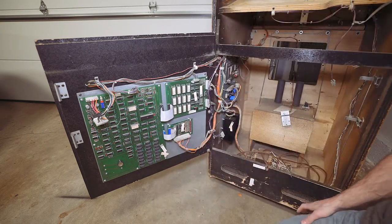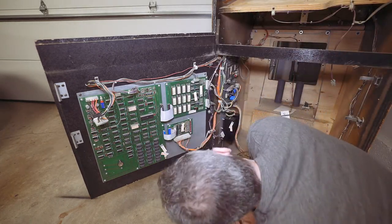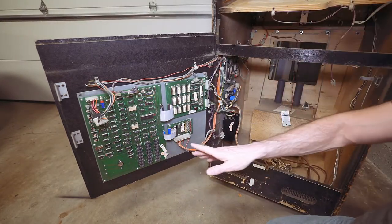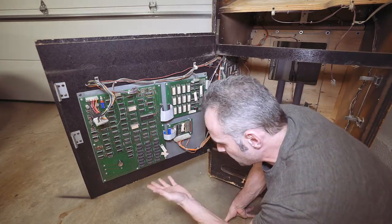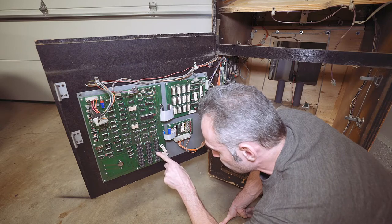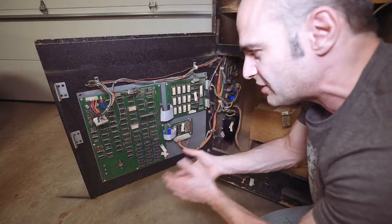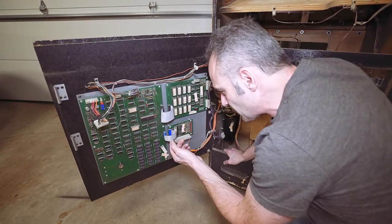You can switch to a little kit that feeds five volts to the RAM with a different set of five-volt RAMs. You put in this little kit from Bob Roberts — it's just a little wiring harness that sends five volts instead of twelve to the RAMs. Looking at the RAMs, they're 4164s — I believe that is the five-volt RAM. Every one of these is exactly the same, which tells me they were all changed to five-volt RAMs. In their original state they burn out so often you'll see all kinds of different RAM types mixed. I'll verify it later, but it looks like this board has had the five-volt RAM kit and the button battery — the two standard mods you always want to do on Williams games.